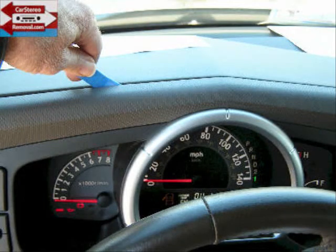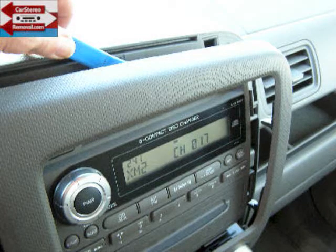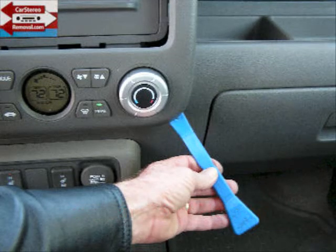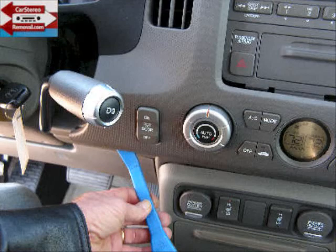The stereo is seen in the shop for the CD changer not working. A reset may work on this one — in order to do the reset you will need your stereo code. If you need help with that, we have a video for Honda radio codes at carstereohelp.com. Disconnecting the battery for five or ten minutes and then hooking it back up can cause the CD changer to reset itself and start working.